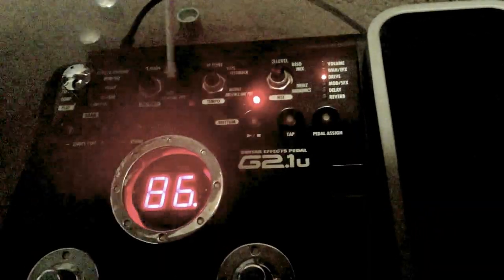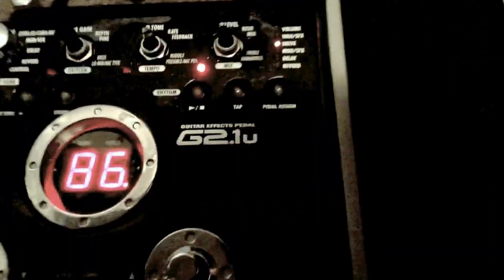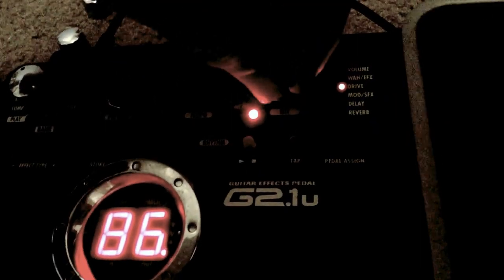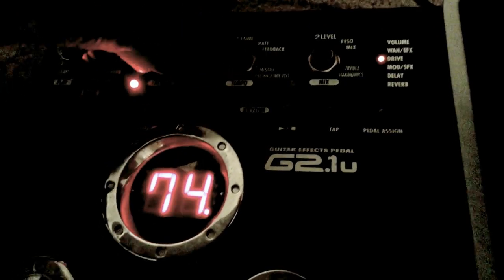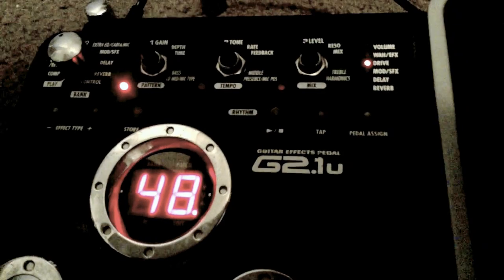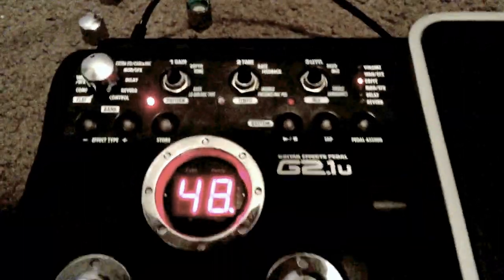Give it a really good blast. Let that all evaporate. It's leaving a bit of a sheet of ice on the front of it. Let's see how it functions now. It's kind of frozen in its socket, but it's doing pretty well. That is a huge improvement. I did not expect that to be so easy, GearFacts friends. I thought that we'd be taking these collars off and digging a little bit deeper into the mechanism. But there you have it — get yourself some compressed air. It'll really free up the dials on your guitar effects pedals, at least for the Zoom G series. It works really well.